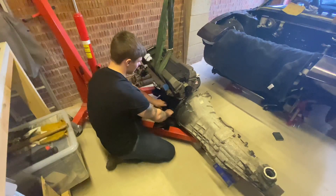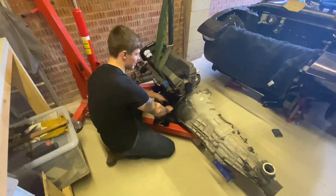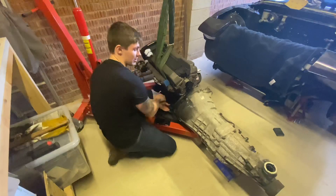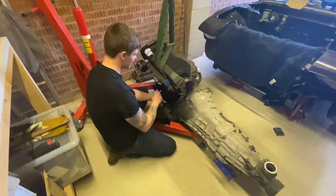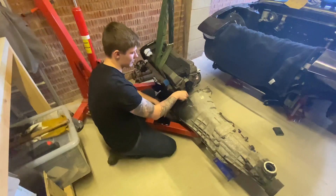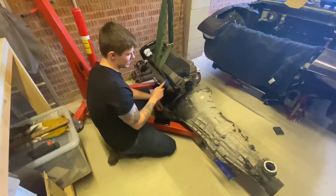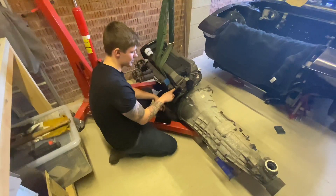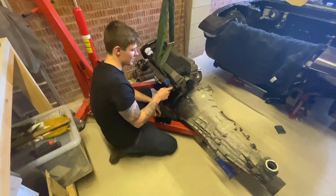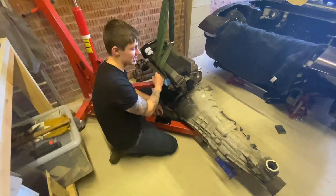This is the exhaust side for the turbo. We've got another exhaust manifold — a proper sprayed-up one — because this one's cracked and we're just using it to help lift the engine at the moment. The new one is all painted up and heat-treated. We need to take that off, get some exhaust studs, get a new gasket, get the manifold on. Then this side just needs the turbo, which I haven't ordered yet.